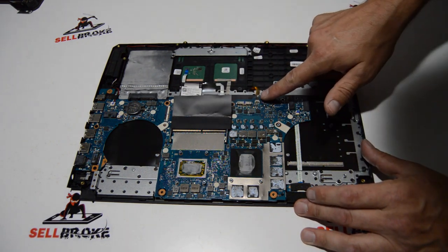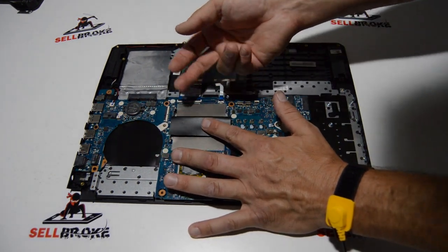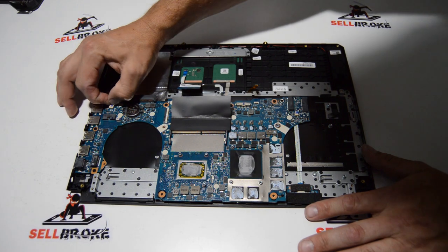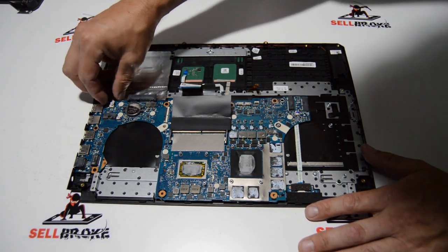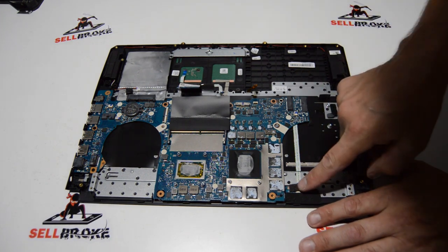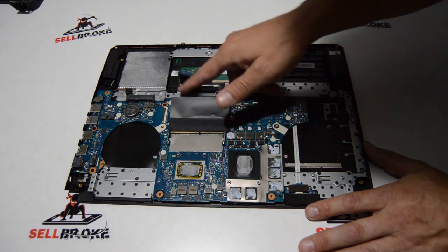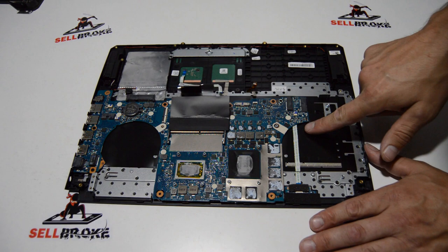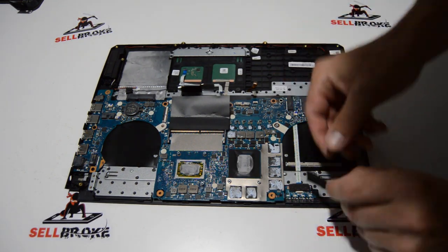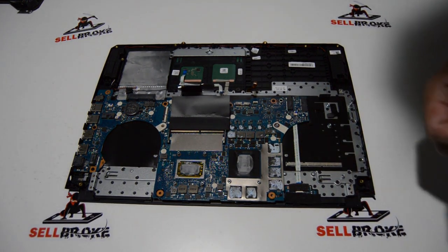For the keyboard backlight, the retainer is on the back side of the connector. The touchpad and keyboard have it on the front side — just flip it up, pull it out, then flip it back down. There's another one for the speaker — just pull straight out. There also looks like a power button connection on the bottom side of the motherboard, and what looks like an LED board. Now let's remove those remaining motherboard screws.